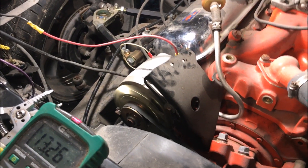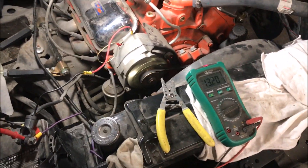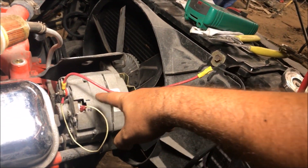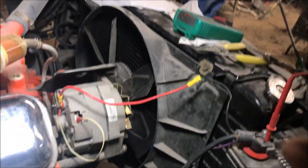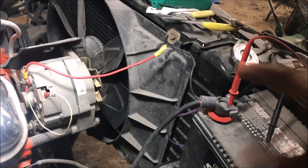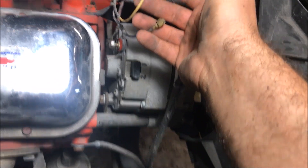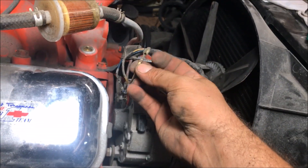It kind of struggles or kicks in — now we're charging. You see how it charged without number one hooked up. This is the easiest way, but it kicks in — kind of hesitates, sometimes it'll chirp — but it charges perfectly fine. For a race car, tractor, or dune buggy, wired up like that is fine. But on this car with factory wiring, if you were going to run a one wire alternator, these two factory wires right here — you just don't run them. You've got to remember this is a voltage sensing wire, so these need to be cut and capped.